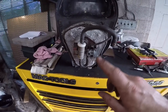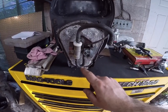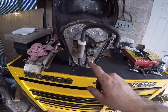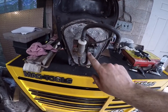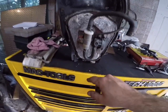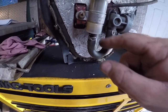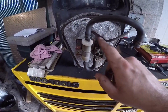If you look at the fuel system that's on it right now, I did replace the fuel filter but it looks like I might need to replace it again. The problem I had before is when I had the tank full of fuel I would come back the next day and the floor would be completely covered in fuel, because these hoses were swollen. Gas would coat the inside of the hoses, they would swell up enough to leak, and as you can see they're not really held together the best — they're kind of wire-tied or safety-wired together. So I'm going to show you what I did to solve this issue.